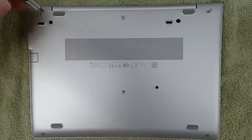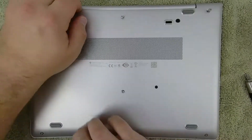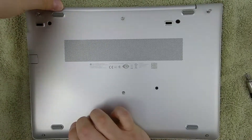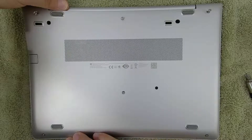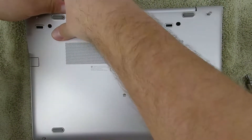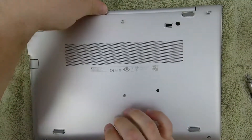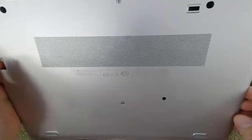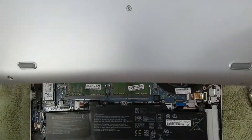Start at the top left of the laptop inside of the hinge — I was able to do this with just my fingertips. Pull up on the lip while holding the hinge to keep the laptop steady. You'll hear that first painful pop and then it gets easier after that. Run your fingers along the remainder of the hinge, gently pulling away until the top pops open, then pull the rest of the cover off.